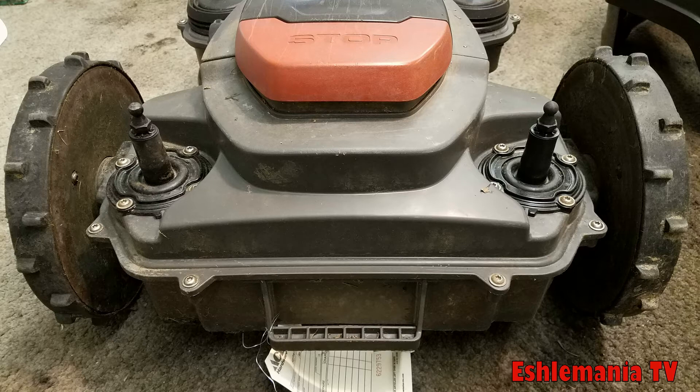The big question is what would cause one of these sensors to break like this? That could be a number of things. A few obvious ones: the mower got lodged under something — these wheel motors have a good bit of torque, so it could push that body a decent amount under something like a car parked in the yard or in the driveway. It could also run into your deck, a fence post, or under a fence — things like that over and over again can slowly cause that flange to weaken and break. Another thing could be an animal like a dog that jumped on it, somebody stepped on it, some kind of hard hit to that back corner, or maybe you bumped it with your vehicle.